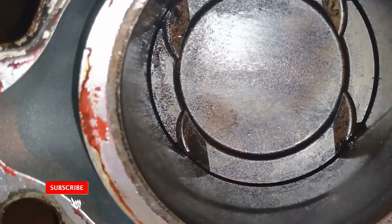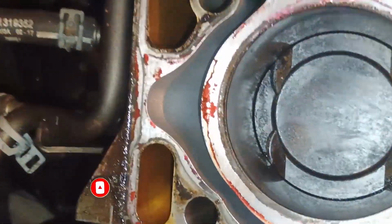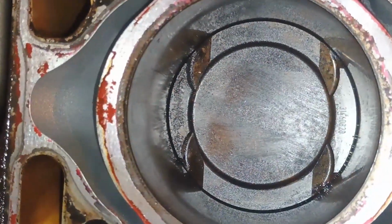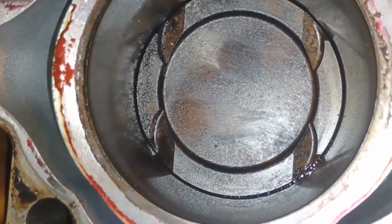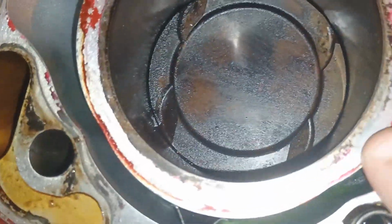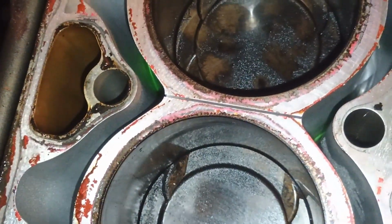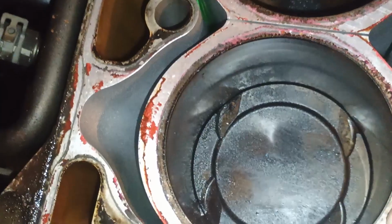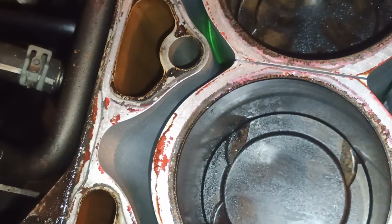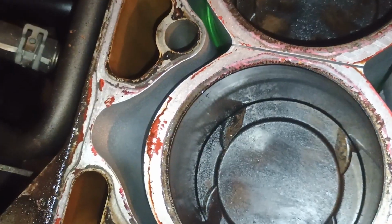We're going to hone it ourselves on the car. I decided to not remove the engine for now, because we're not losing anything. By the way, this engine, despite being cast aluminum, does have sleeves in it. Steel sleeves. That means it's not like the BMW Alusil surface. Here you can hone it or bore it the same as you can do with normal old-fashioned engines.